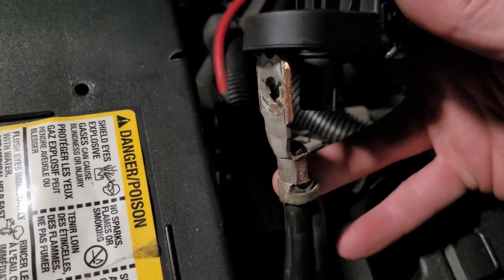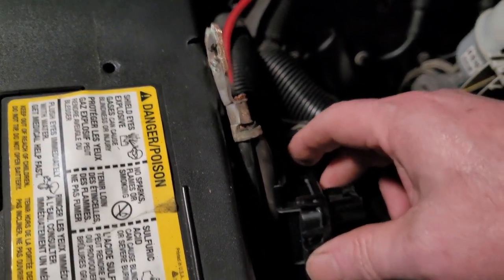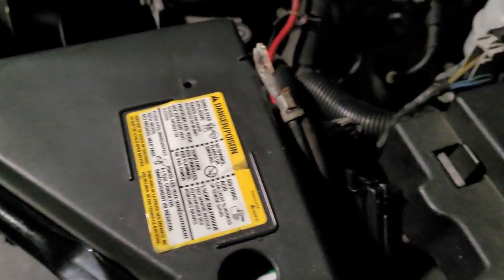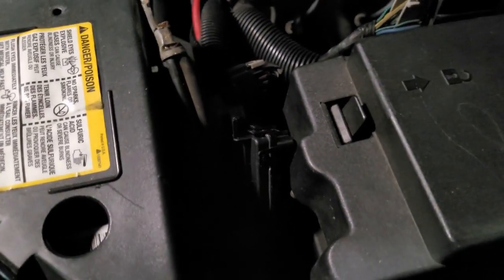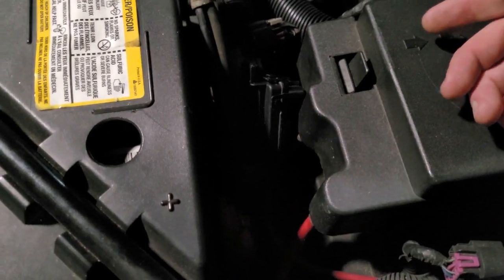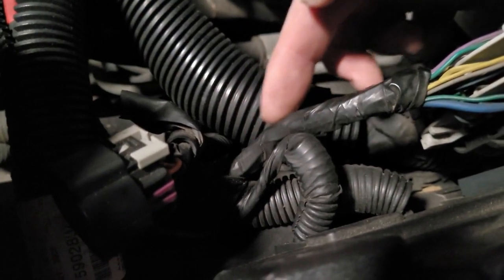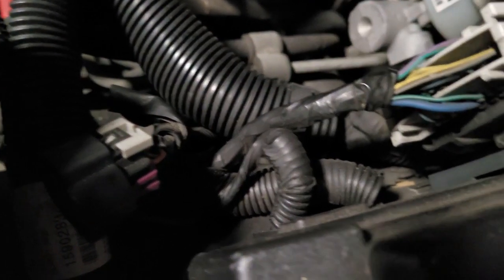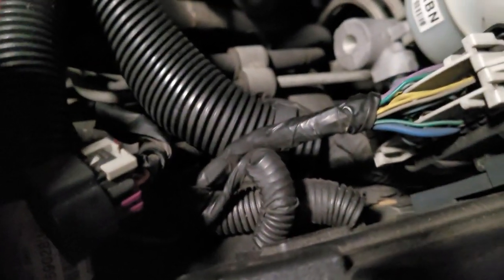I kept the original crimp on that end, so now I'm going back together with it. I'll tape this up — not with electrical tape but with wire harness tape. It's not sticky, it doesn't leave that film like electrical tape does when it gets hot, so it's good for under the engine bay. They sell it real cheap — it's what General Motors uses from the factory. So we'll tape it up and see what happens.